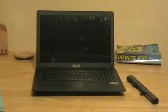This video was about how to replace an LED screen in the Asus X551CA laptop. The first step is to unplug it, which I assume you're good with, and the second step is to take out the battery, which turns out to be one of the trickiest steps. Unlike most laptops, you can't just pop this thing out. You've got to unscrew the back and take off the keyboard and take out the battery.